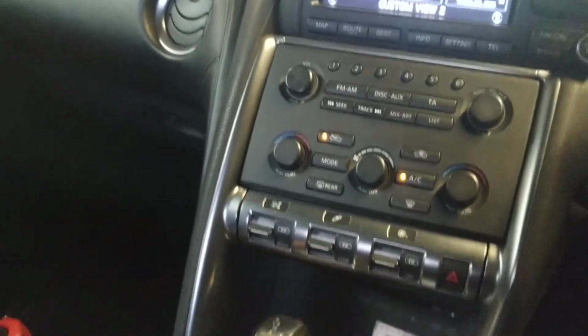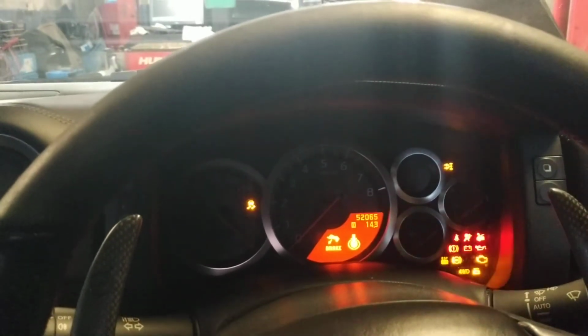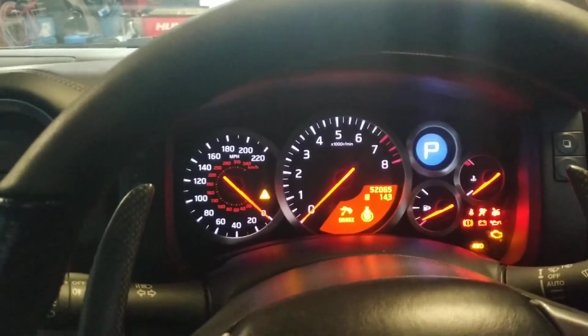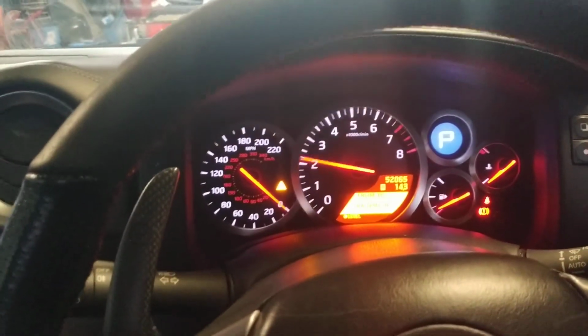So to do that again, ignition completely off. Turn the ignition on. Wait for about 5 seconds and insert your new code that we've changed it to. So 1, 2, 3, 4. Double flash. Start your vehicle. Really clever, really straightforward.